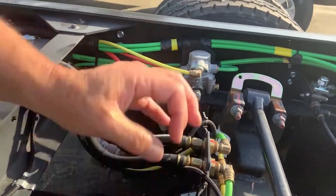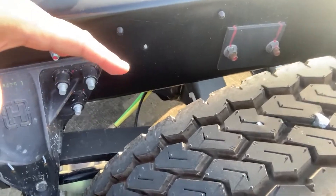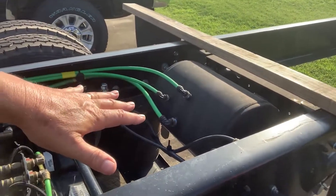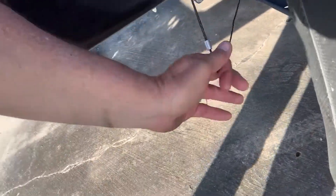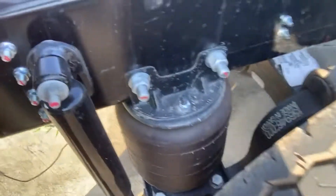These are our service brakes that come into our brake chambers or brake pods. What is the difference between green and yellow? The green is our supply side for engaging service brake pressure to lock down our brakes, and the yellow is for parking. The wet tank on the Isuzu is placed behind the rear axle for the braking system that has the most amount of pressure.